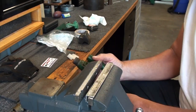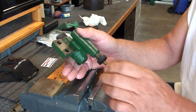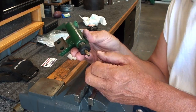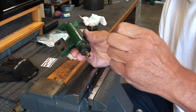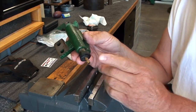And the way I've got this fixed up, I'm simplifying matters down in the tank on this one. I just use a rubber hose with a little weight on it down in the bottom of the tank. We call it a clunk. And that lays on the bottom of the tank and it picks up fuel.